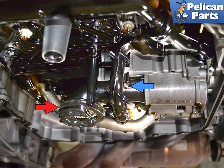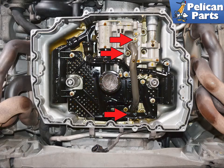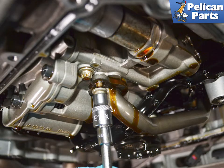Note the orientation of the rubber pickup boot, indicated by the red arrow. Use an E10 Torx and remove the three screws holding the oil pressure tube in place, shown by the red arrows. The single screw that holds the line to the case is up behind the baffle and requires the use of an extension. Be prepared when you remove the two screws on the oil line, as oil will pour out.